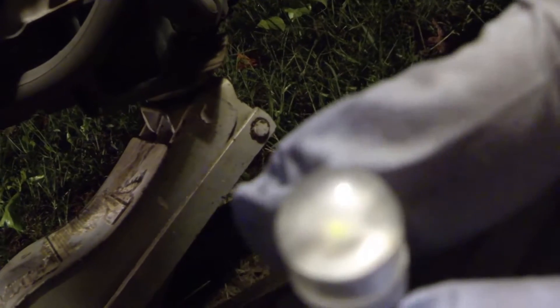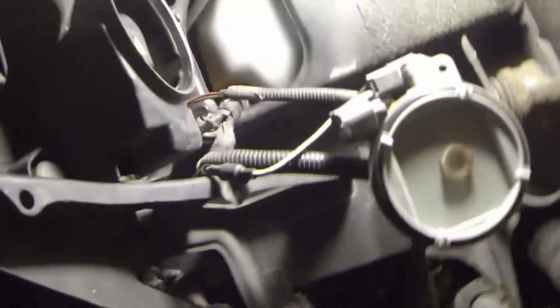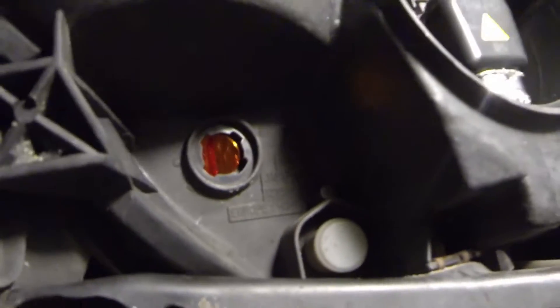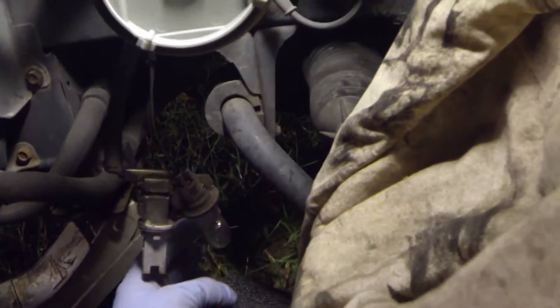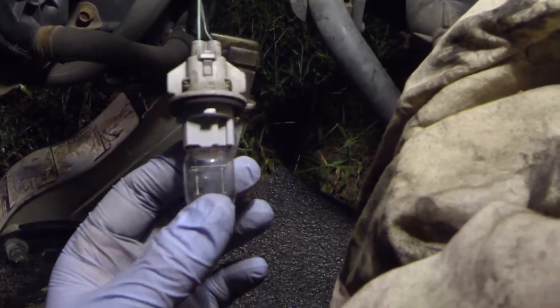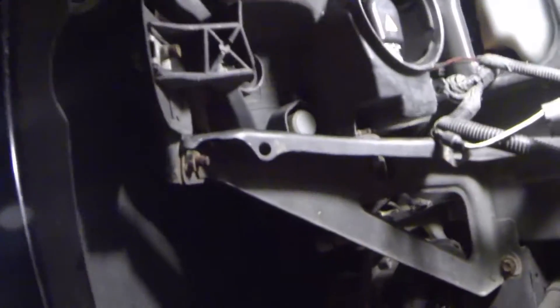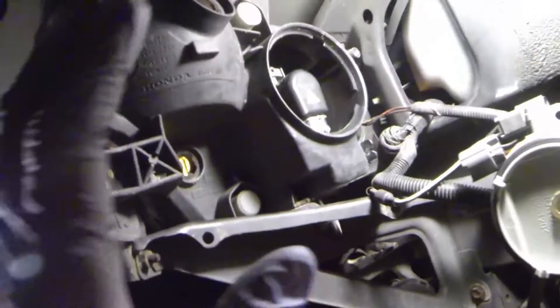This is a little LED bulb. The nice thing about this is that, being it's just a simple indicator light — your parking light — there's no flashing involved. In order to install LED flashers or blinker lights, you would have to install a resistor and wire the resistor in.